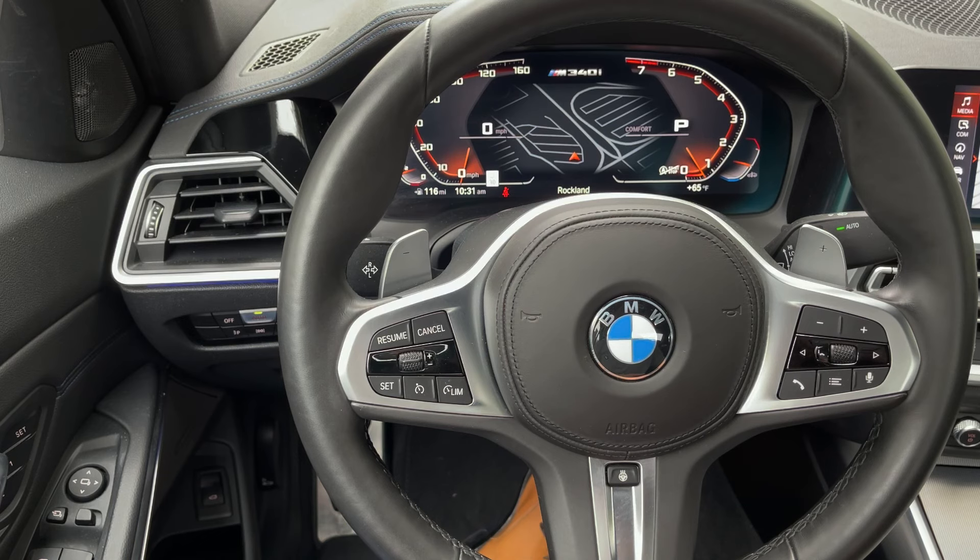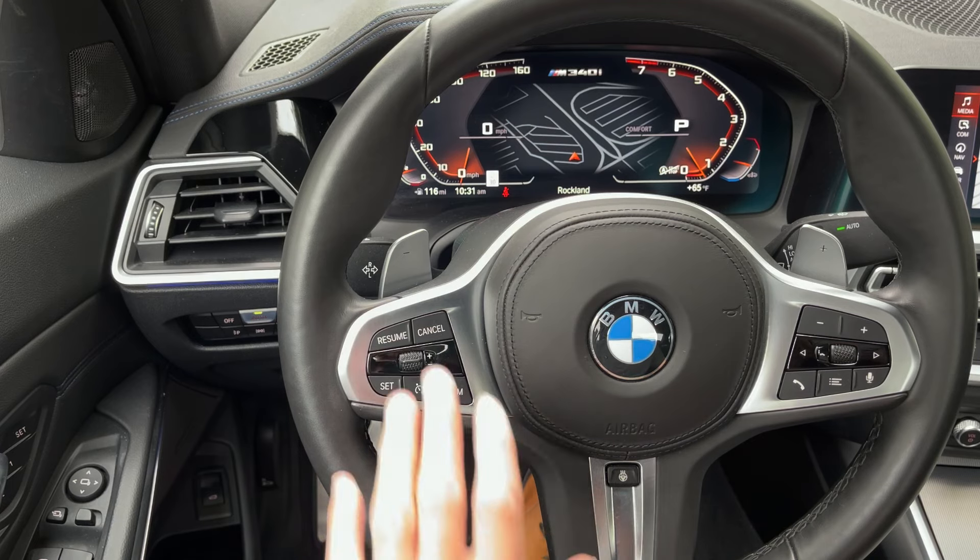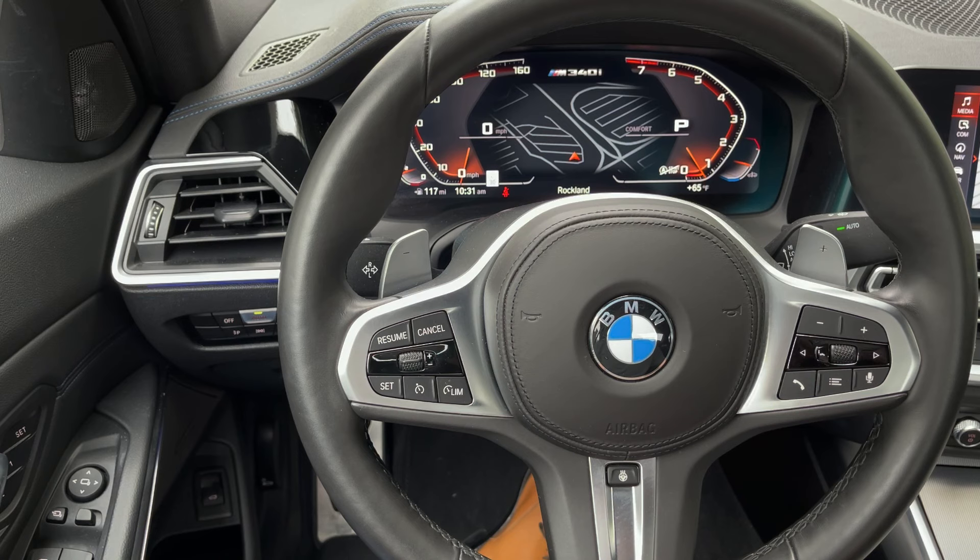It's really cool. There's a function called Assist Plus that provides unlimited hands-free driving under 40 miles per hour. So if you're in a traffic jam and you're actively using the Driving Assistance Professional technology in a stop-and-go situation, touching the steering wheel once every 30 to 40 seconds, and you get into a really congested area, a message will pop up called Assist Plus. It will ask whether or not you want to use that function — you always have to be asked. I show you real time when I get stuck in traffic how that works.